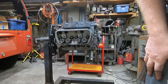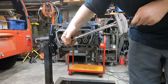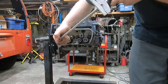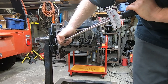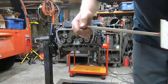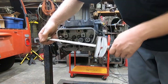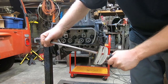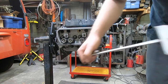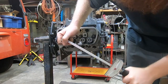Let's see if everything else is at the same point. That one got up to 25. Those ones are good. I'll put this one up to 25 as well. I like how uneventful this is. I'm following the torque sequence from the Tom Wilson rebuild book. We didn't pull any studs — let's go back over and re-check.